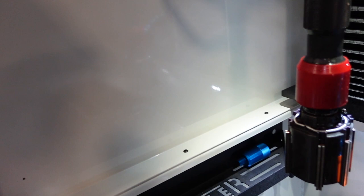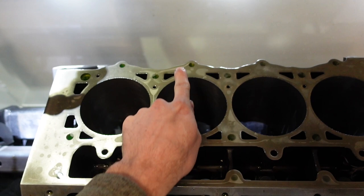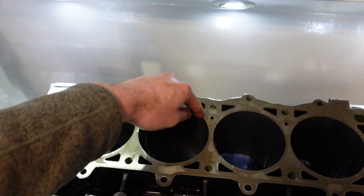What's also really slick about this machine is it's a six-stone holder. Traditionally these hone heads are a four-stone holder, and the bore might be straight one way but a different diameter another way — it's not a perfect circumference. Whereas the six-stone holder achieves that. Whenever it hones, this bore is completely 360 degrees the exact same diameter, so it's really trick.